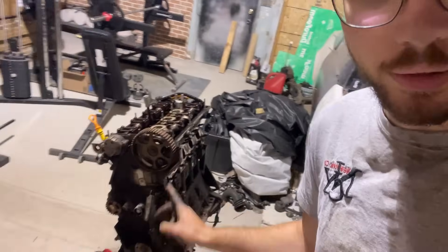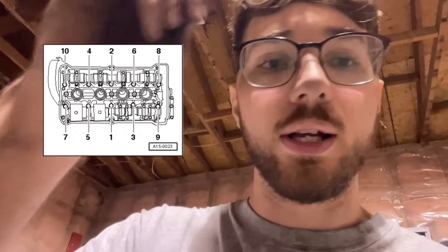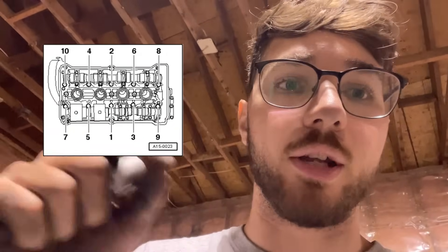The belt is off on the front. Now I'm going to pop the head off. You need this special polydrive 10mm socket key. It is important that you undo the head bolts in reverse torque sequence — starting from 10 back to 1. I'll quickly loosen all the head bolts in reverse order and then lift the head off. Hopefully I'm not missing anything. Once it's lifted we'll inspect — hopefully the valves aren't bent, which is pretty common on these — and then check the pistons.